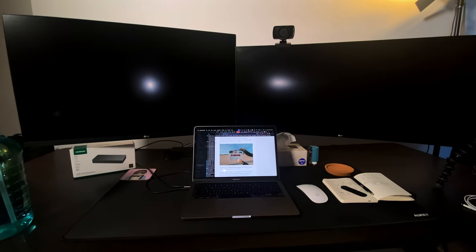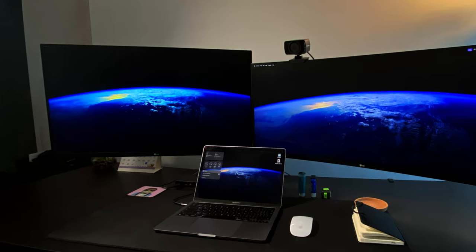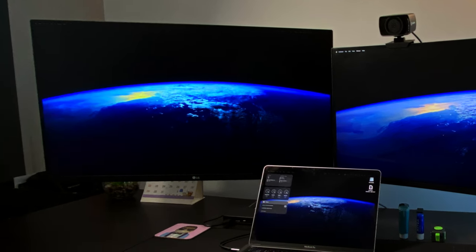Additionally, I just wanted to double-check that my ultrawide monitor is running at 100Hz, which is its rated refresh rate — and it is, but only over DisplayPort, which is normal because even without the dock, HDMI 1.4 doesn't have enough bandwidth for that refresh rate at 1440p; it caps it at 75Hz. My 4K LG monitor is working perfectly fine at 60Hz, and there haven't been any issues over the last month of using it.